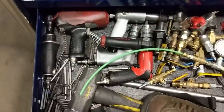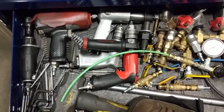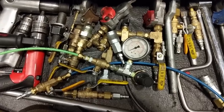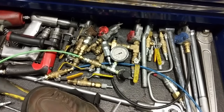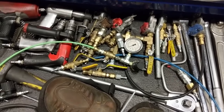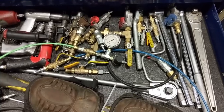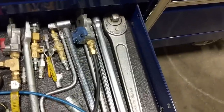Here I keep air tools I don't really use much since switching to electric — kind of a shame because I spent good money on them and got fair use out of them. I've got some random fittings for testing air systems with shop air. This one I made up — I got burned one time, couldn't find an air leak, the pressure was dropping but I couldn't hear it. The truck wouldn't maintain air and I suspected the fan hub. I rigged that fitting up so I could hook right to the fan hub and run it with the engine off. Sure enough, as soon as I put air to it I could hear it leaking.